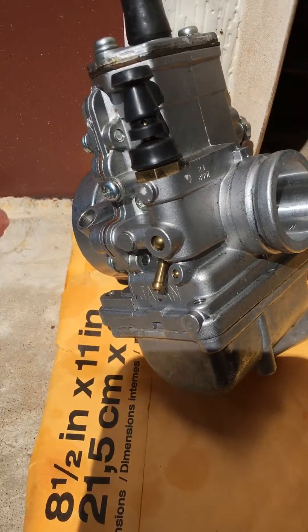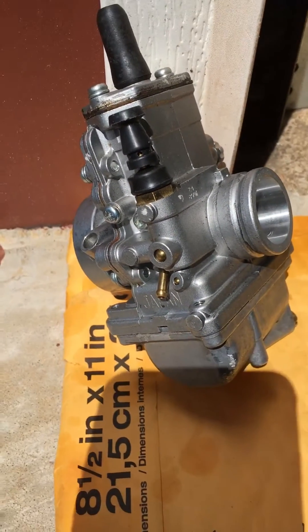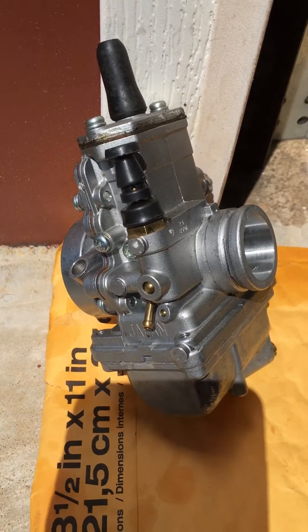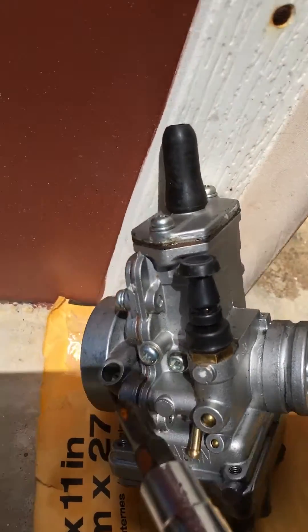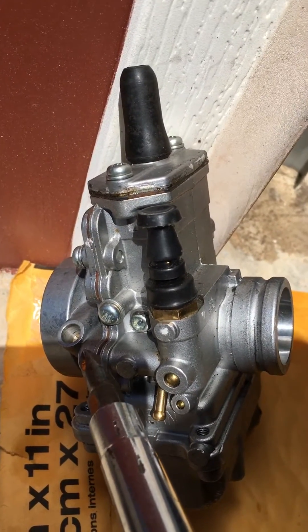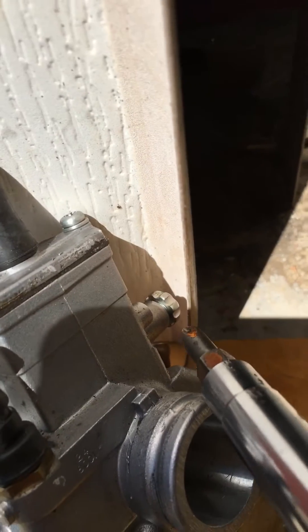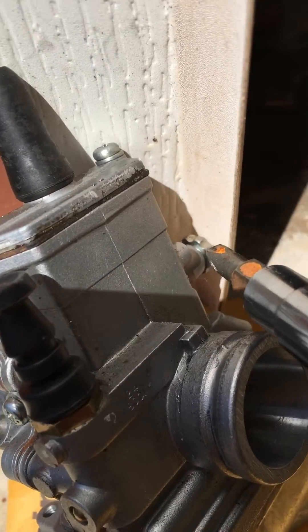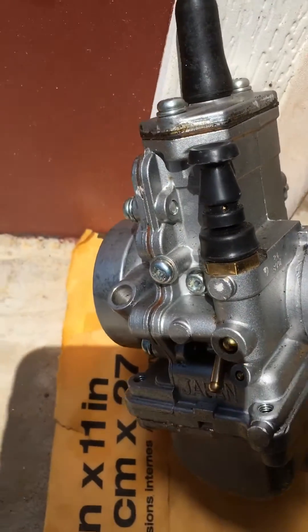To make things real simple, I'm going to make videos one part apiece explaining each thing. Familiarize yourself with your carburetor — that's your air mix screw, which determines what size pilot jet you use. On this side, it controls the slide going up and down; it's simply your idle. This is your float.